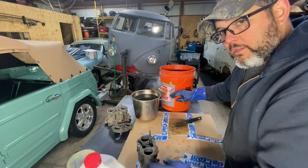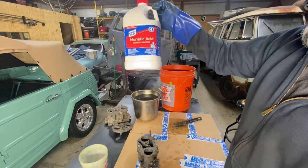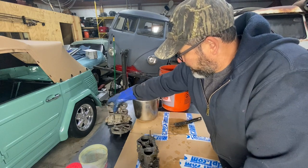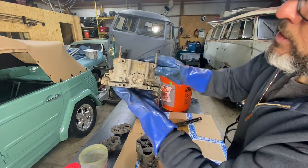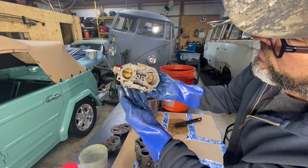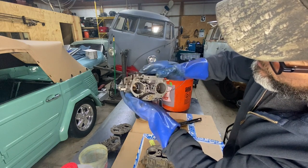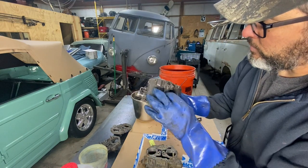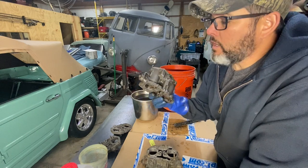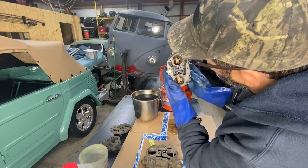So: 20 minutes total, two and a half gallons of water, 24 ounces of muriatic acid — I got it at Lowe's for $9.99. This was the condition I dipped it in — all crusty and nasty, the inside was even worse. It came out turned out really nice; this is ready to go. After I get the rebuild kit I'm gonna install it, run it in my engine and see how it works. I think it should be good — it really looks great.